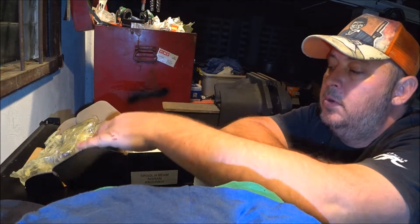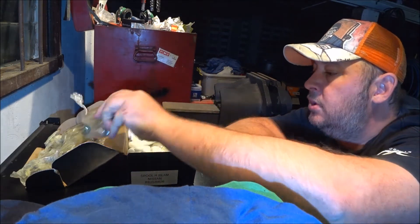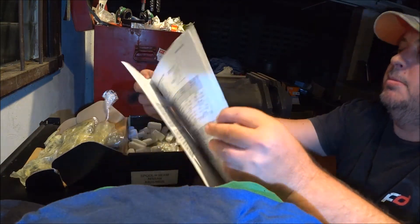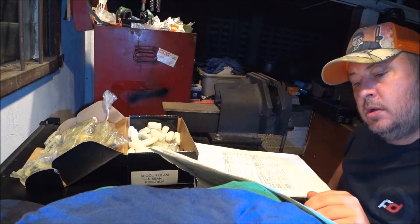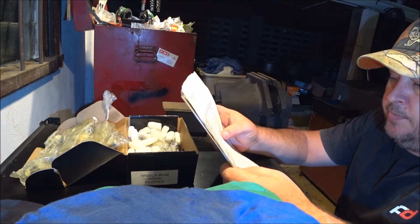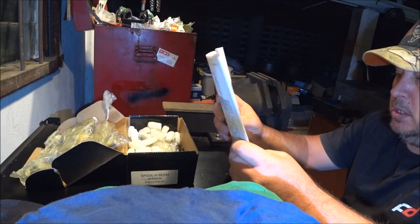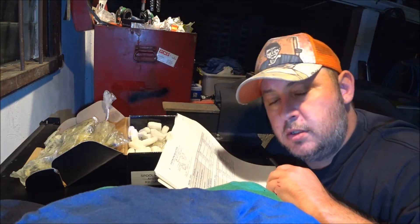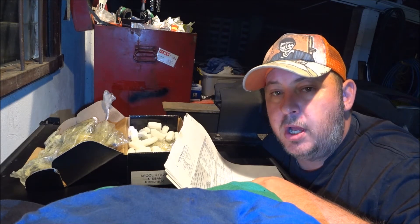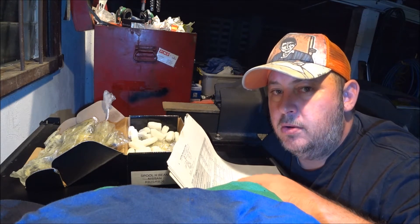Alright YouTube and the Internets - rods. They should be the same as the factory ones, so I'm just going to use the factory service manual to check those. This seems to be my favourite piece of reading material. Conrod small end diameter is 21.06mm. I've got the camera in a shitty spot - that's too small for my ball gauge to measure, so I'm going to do those with the verniers. I have slipped them onto the pin, they seem pretty good, but I'll have a bit of a double check now.